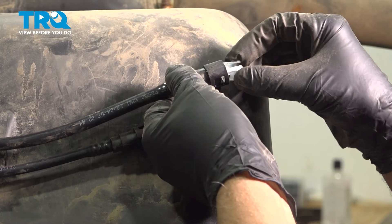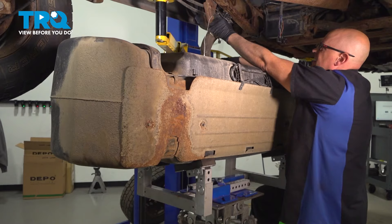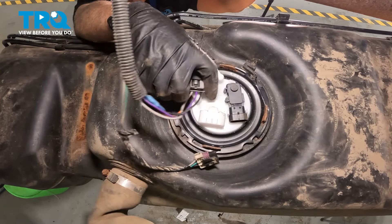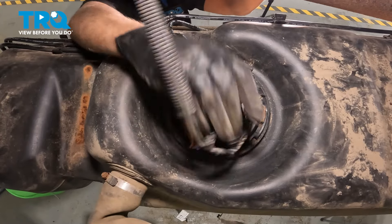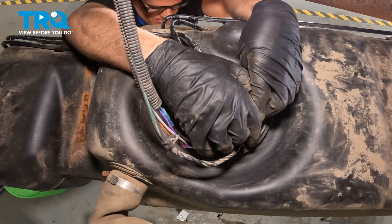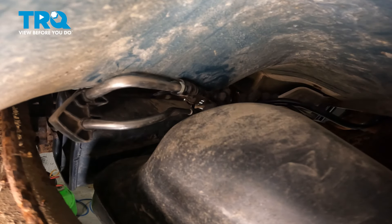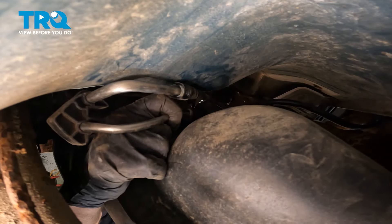Now you're good to put the tank back up. Attach these to the hoses — just push those in, same with this one. Push it in and lock it down. We'll go up with the fuel tank — just make sure you grab the filler neck and let that go up first. Once it's high enough, you want to connect the connector to the fuel pump — line that up, lock that down, push down on the lock. Fuel tank pressure sensor — lock that in. Looking good. Connect the fuel lines before you push the tank all the way up — makes it a little easier. Those are locked in now. I'm just going to try to pull that apart — yeah, those are locked in.